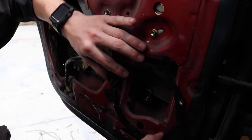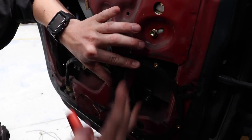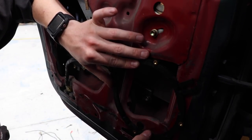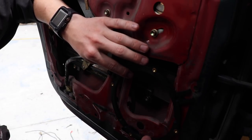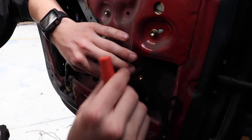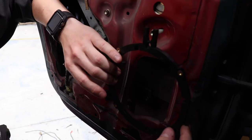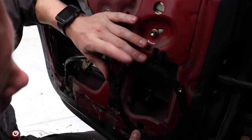I thought about rotating it and mounting it like this, so that the speaker uses a plus-shaped cross screw pattern, and having one of them on a speaker lip like I have in the front to make it match. But if I can make four screws go into the middle, why not? Also, if I did that, I'd have to go even lower because the screw might get in contact with the piece which comes through here. So even though it doesn't really match the front, it makes way more sense to have it upright vertically. All right, so let's line this up and try and center our hole.